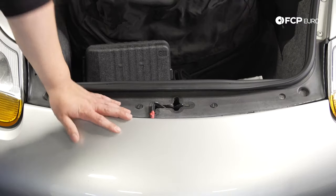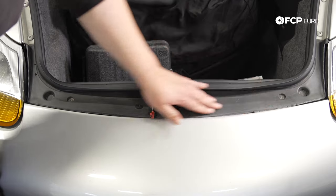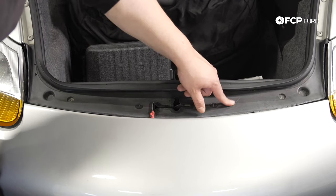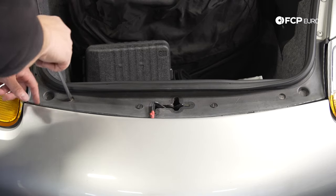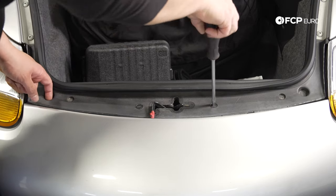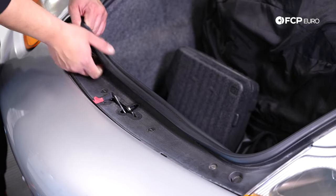To get started, we're going to work on getting our front bumper cover off. We're going to remove what you can call a bumper surround or radiator surround — basically a little grill — held in by four plastic rivets that just twist out. I'm also going to lift up the weatherstripping here so it's out of our way.